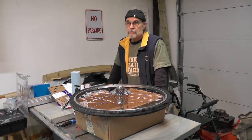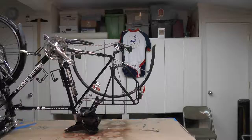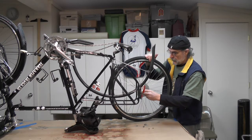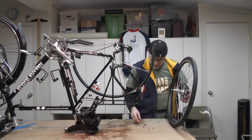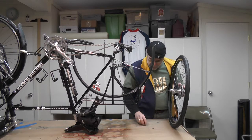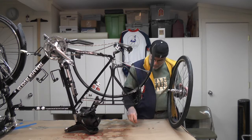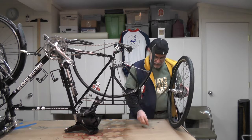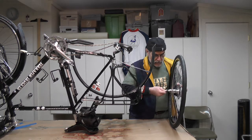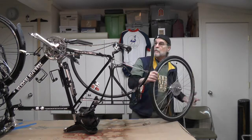I'm going to go ahead and put this back on the bike, put the pitlock skewer back on. I have the wheel here. I'm going to go ahead and put my skewer in there — my skewer has already been greased. A little spring, the actual tension washer. There's a Teflon washer in there as well — luckily it stays. And then the coated pitlock, or pit nut. Put that on as well. I'll get it just tight enough to fit on there — pitlock skewer on there now.